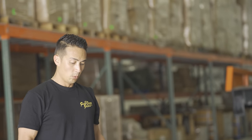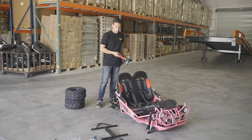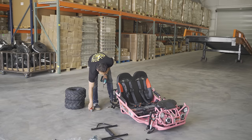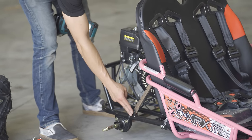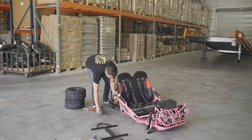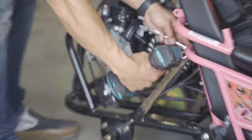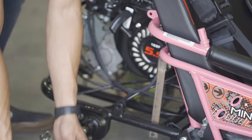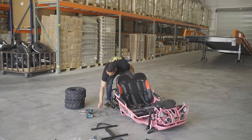Now that we have the back seat on, we're going to install one of the rear shocks. You'll see that one of the shocks is already on. On the other side, you'll see a piece of steel from the back of the seat to the rear swing arm — let's take that bar out and swap it with the shock. They included one steel bar just so it wouldn't compress during shipment. Friendly tip: make sure to put in the bottom bolt on your back left shock before taking out that bar.